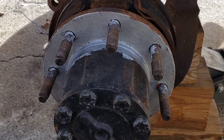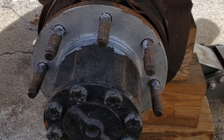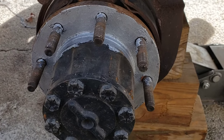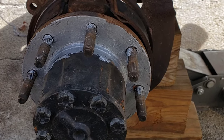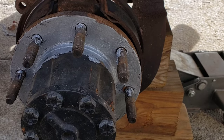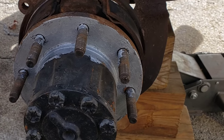I also apply a very thin line of anti-seize where the drum and hat meets the axle stub, so you don't have to beat it off with a hammer. Mine were getting a little stuck, so I went ahead and put some anti-seize on both sides. Now I'm going to install the drum and hat, and then adjust the parking brake.